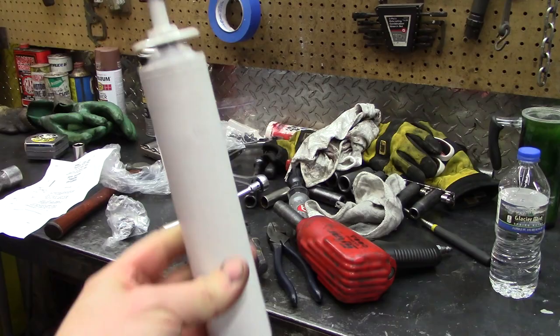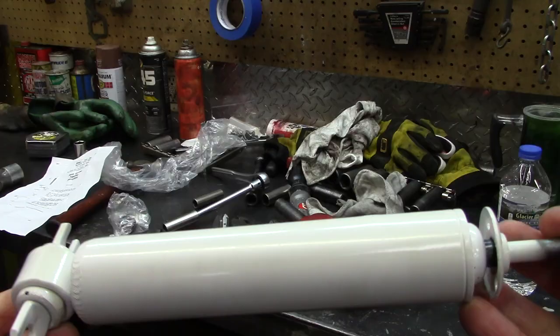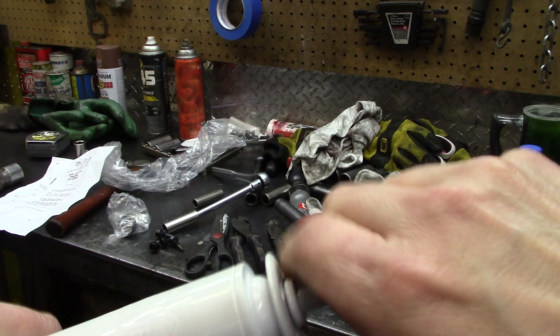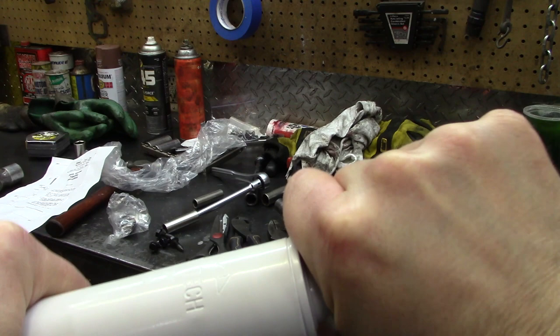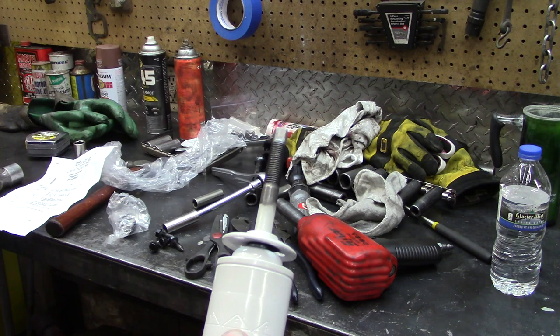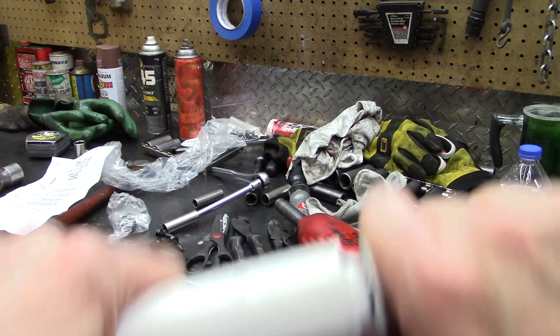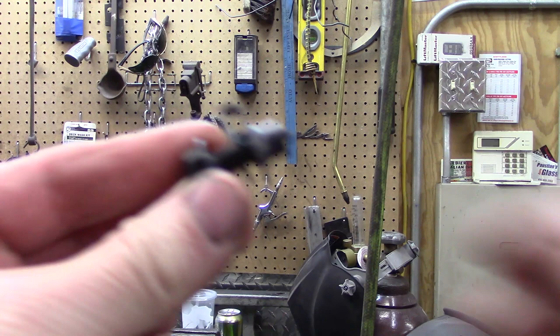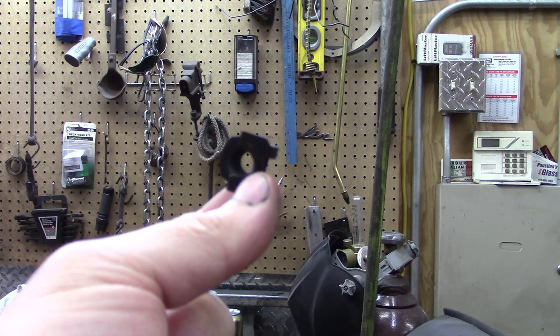We've got these adjustable shocks — I think it's a Competition Engineering shock, just rebranded as Summit. Basically you push it all the way down, then start rotating until you hear the loud click. There are two faint clicks. The loud click is 90-10 regular, the next faint click is firm which is 80-20, and the next one is extra firm which is 60-40. We're going to throw these in at 90-10 and take the sway bar off later. To mount those shocks we were missing a clip, so we got some new ones. There's a little lip and it clicks right up on that control arm, making taking the shocks in and out easy, which we'll need to do to adjust them.